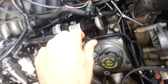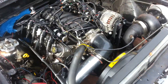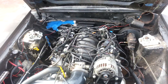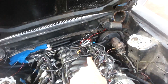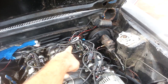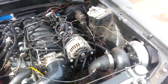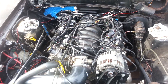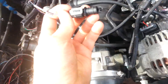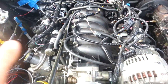You can even use my stock tune. This is a 4.8 with GT500 injectors, LS6 cam, BorgWarner. Obviously you should tune it yourself, but there's nothing stopping you from running my tune. There's a ground on the back of the head that comes through the cable. There's also a ground inside by the kick panel where the ECU is. Outside that, it's literally plug and play — flip the key. This sensor is included as is the pigtail. It's all here. It's complete.